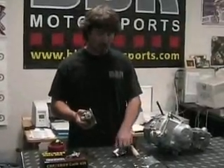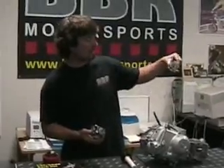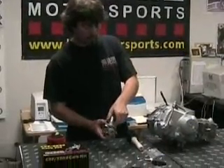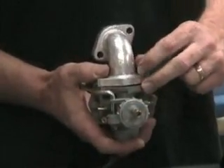The first step to putting the carb onto the engine is to bolt the manifold on. There's a curved side and a slanted side — you just put the straight part right on here. Grab your allen bolts and screw it right onto the carb.